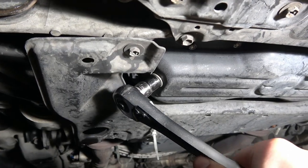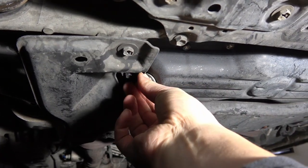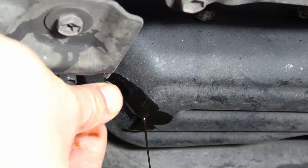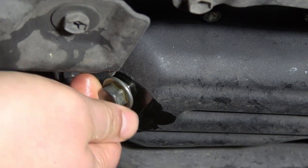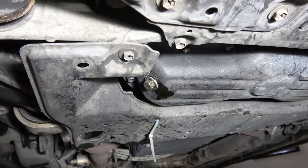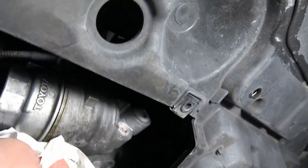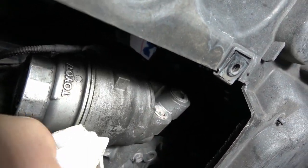That's a 14mm plug. I'll crack that free, get our drain pan into position, and twist this off. Alright, that's been draining for a while now — pretty much most of the oil is out. I'm going to go ahead and put the plug back in. If you've got a crush washer, go ahead and use it. I don't have one and there wasn't one there; it wasn't leaking before, so I'm just going to put it back how it was and tighten it down. I'll give everything a good wipe around the bottom to make sure I don't have any oil dripping on the driveway or in the garage.